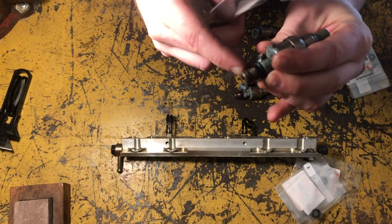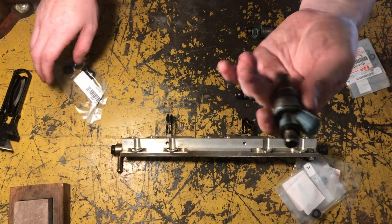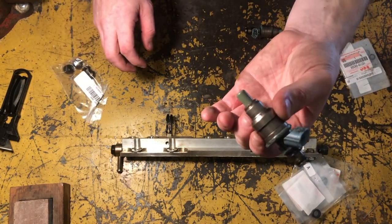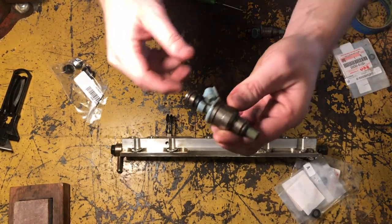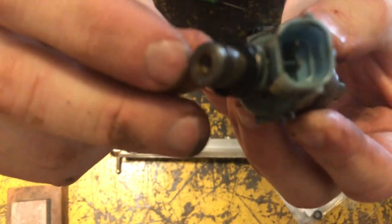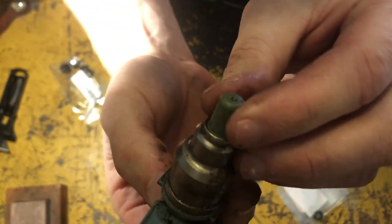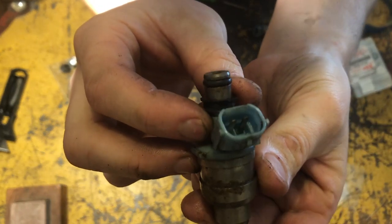These are kind of dried out. It's a 1993 Suzuki, so it's always a good idea to replace the rubber components of the outboard if you know it's old. I do want to clean these fuel injectors a bit because they're pretty dirty. I don't want any contaminants to get in the screen, so I'm going to tape those up so nothing gets in there while I clean it.